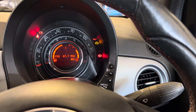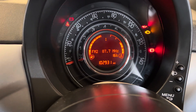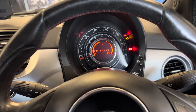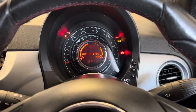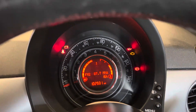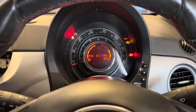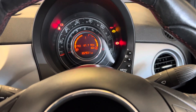Hello everyone, welcome back. Today we've got a Fiat 500 with a flashing mileometer, as you can see. This is a common fault on these Fiat 500s and also a lot of other Fiat products — the Citroën vans and similar. Something on the proxy system has detected no communication, or the wrong part has been fitted. In this case it's the Blue and Me module, which is common on these Fiat 500s.